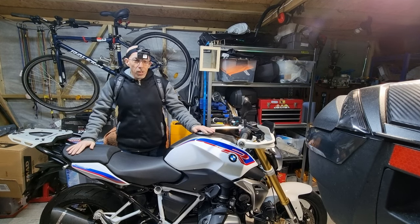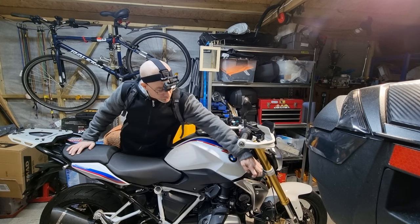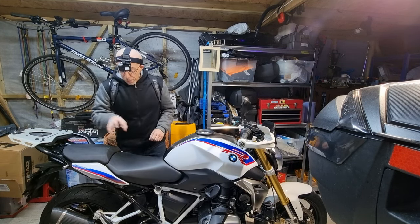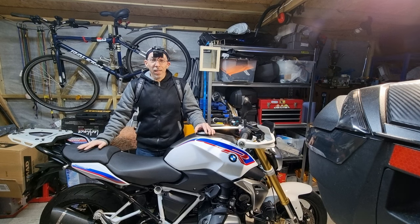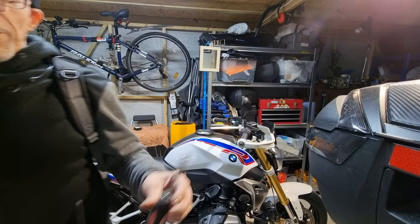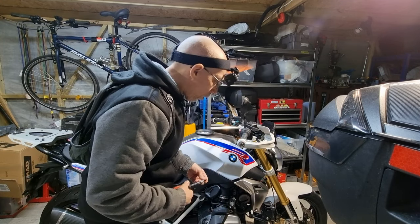Right, let's start dismantling the motorbike. What I think I'm going to have to remove is this side cover and seats, so let's take all this gear off. Then we'll have a look on the table at the indicator gear that needs to be installed. A T25 torx bit usually comes in handy when it comes to taking the bike apart.